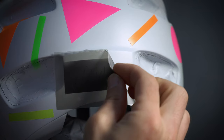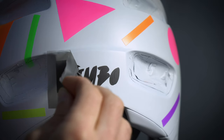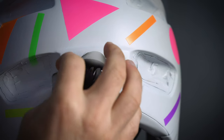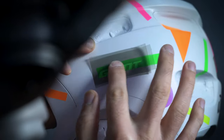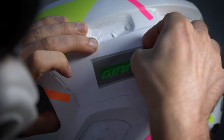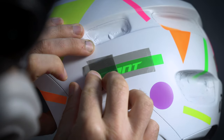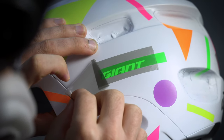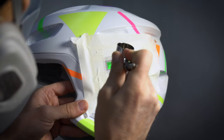It's often, if you've got coverage, a nice light dry sort of coat — in the car repair world they call that a drop coat. A lighter coat sprayed from further away sort of evens out a color. Even for a flat color you generally use it for metallics, but it does help with basically every color. And again, gentle careful de-masking — here we just added some little Giant logos, it's a Giant helmet, and the little Giant logos go into the color sections to spice it up a bit.